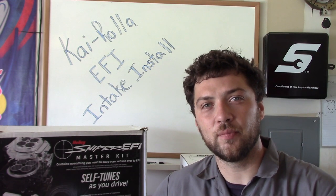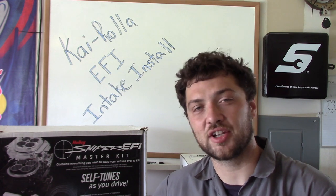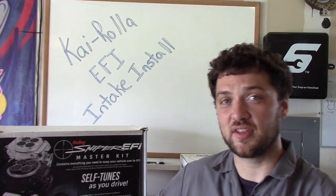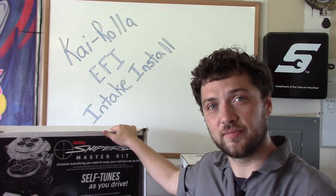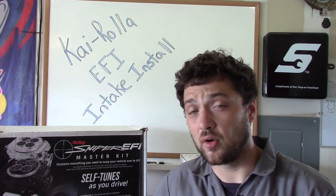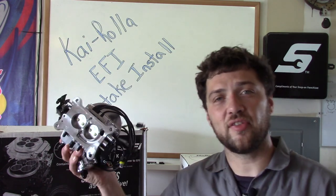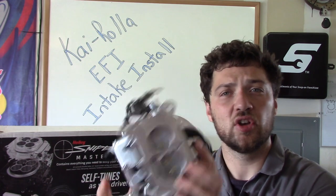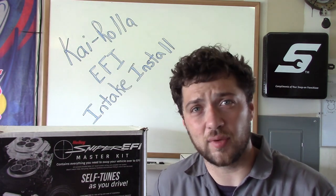As you already know, our plan is to make this Corolla a reliable daily driver by installing electronic fuel injection. The fuel injection system we're going with is the Holley Sniper 2300 master fuel injection kit. There are a few reasons we're going with the Sniper instead of a MegaSquirt or any other injection system. The first is all the sensors and controls are contained inside the throttle body, so there's no external MAP sensor to hook up and no fuel pressure regulator we have to source.